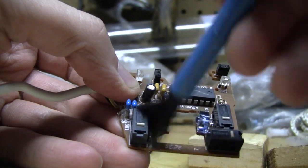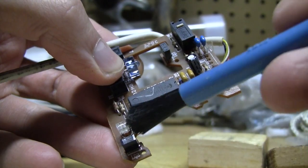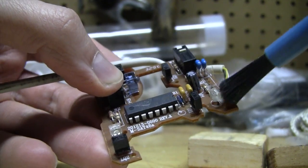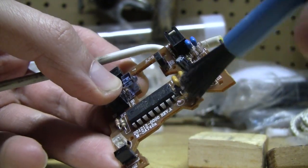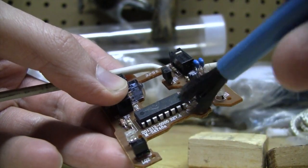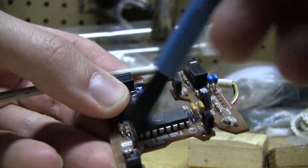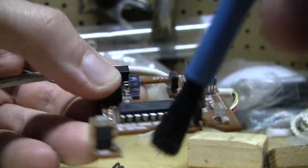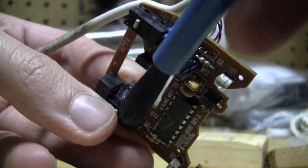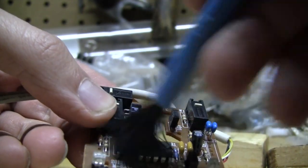Just brush off the dust, get it away from the optical sensors. Those are the little things here that read the movement of the rollerball. You have an infrared LED and an infrared sensor for the horizontal and vertical movement, and that's what reads the movement of the mouse. And it looks like there's another pair here for the scroll wheel. You can see a little LED there.